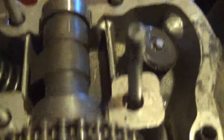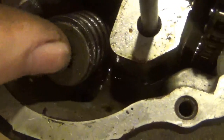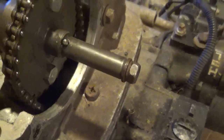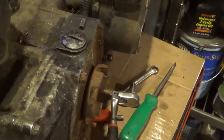To see if the valves were seized, I gave them the old hammer-and-wood-block tap action. What you're looking at is the rust line on the valve, which means I tapped the valve in and the spring did not pull it back — and it's the same for the exhaust. I can move the piston up and down a little bit, but I don't want to move it too much because the valves are stuck in the open position, meaning the piston could hit them.